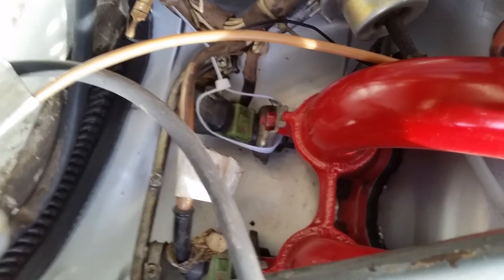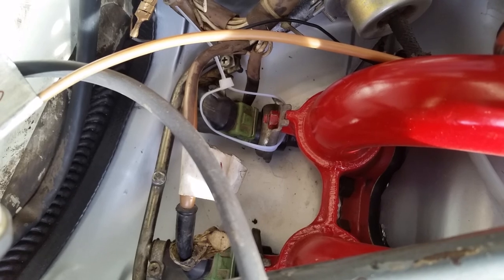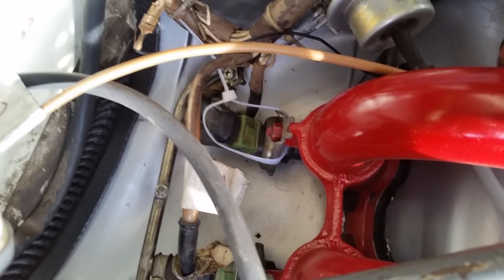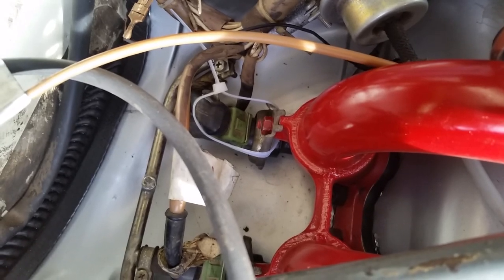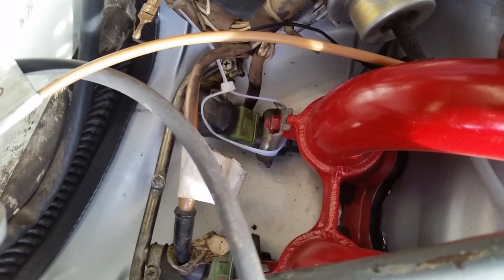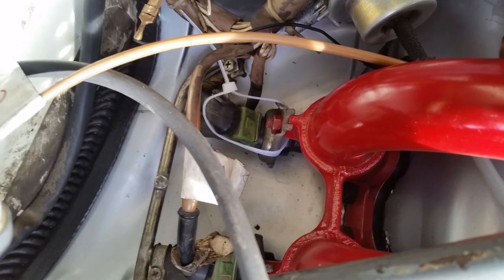It just comes off, you know, just the slightest amount, which loses contact and you lose that injector. So after testing everything I could think of, finally I put my stethoscope up to all four injectors and found that one not to be firing, and figured out that that clip was sliding backwards off. I've put a few hundred miles on it since then. We haven't had any issues at all.